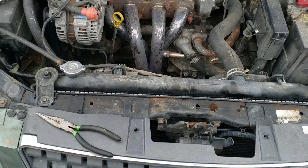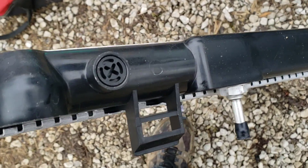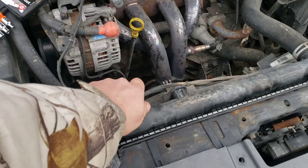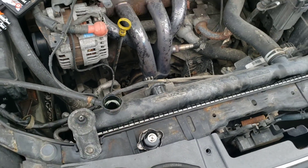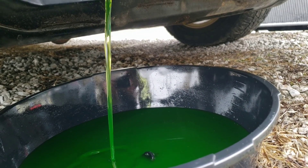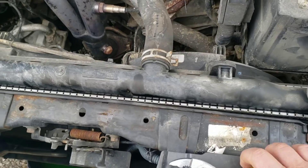At this point, we need to drain all the radiator fluid. Your drain plug is on the passenger side of the car — that's it right there. You'll have to use a real big Phillips screwdriver to turn that to drain it. While you're draining this, you'll want to crack and just take off your radiator cap, because if you leave it on it can create a vacuum to where it won't drain properly. It'll also drain much faster by taking the cap off. You'll want to be prepared to catch up to three or four gallons of coolant.